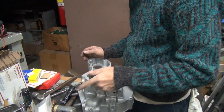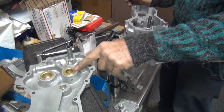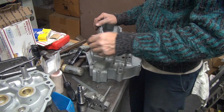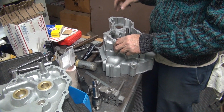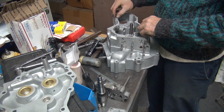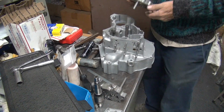And so all we can do now is, next time we'll do the bushings here, we gotta ream this one bigger, and we gotta swap this out to the later bushing. Right. So we'll have to change that out. And then we gotta get the idler shaft in here, and that will make sure that all goes on and off relatively freely there. Now has this been on the motor here yet or not? No. So we don't even know if this fits yet.